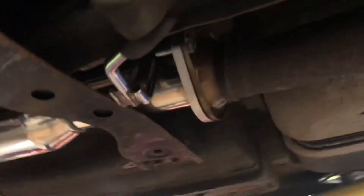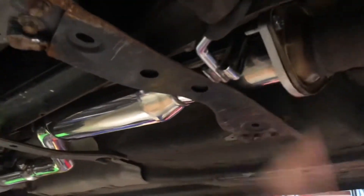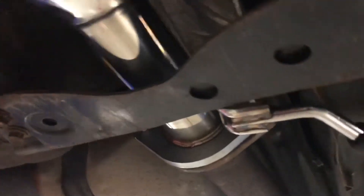This is why I decided to upgrade my catalytic converter. I bought a racing catalytic converter — basically a mid pipe — which provides a little better breathing. The problem with some of these mid pipes is they have either a really bad catalytic converter or they might not even have one at all, meaning you won't pass inspection. I live in South Carolina where we don't have inspection, so at least I don't have to worry about that.